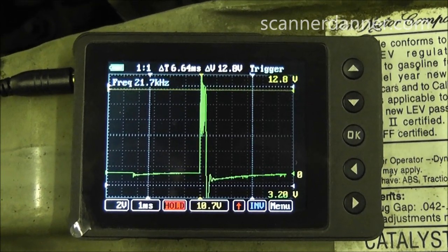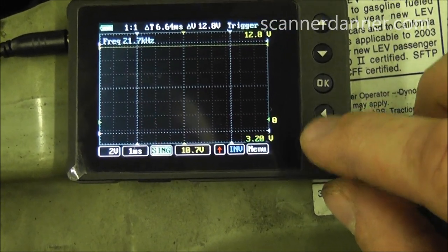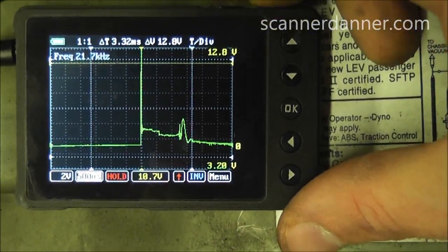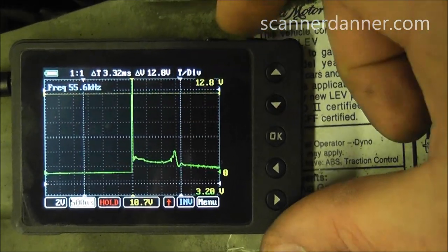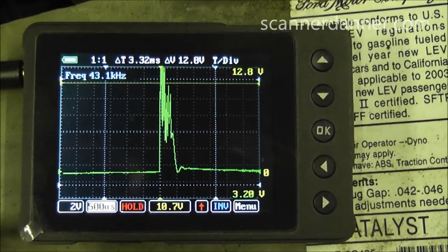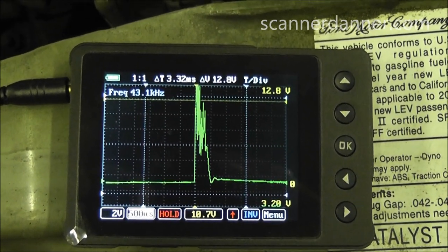I have adapters that we can use it on coil-over-plug too. I'll play around with the time bases a little bit to give you more detail. I'll leave it on single shot and drop my time base a little bit, then snap it again. That was actually a good one — reset it and snap it again. That looks pretty good on that one too; that would be what a good snap looks like. This is an intermittent miss — there it is. You saw what a good one looked like on a snap and what the bad one looks like. Now we need to see if we have a plug, wire, or coil problem. Since plugs and wires were just replaced, we probably have a coil issue.